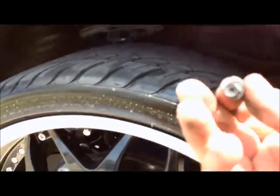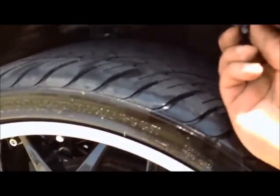Okay, now after removing the 8mm bolt that's under here, all I've done is pull up and out on this to snap it out a little bit. Now, don't pull on your bumper right now. Do not pull on your bumper. There are hidden screws inside. If you don't believe me, you can check out this little tear right here from the first time I took my bumper off as evidence.